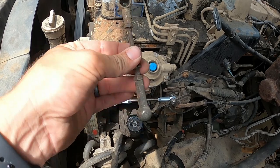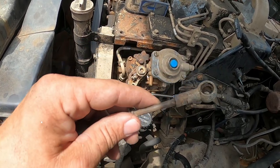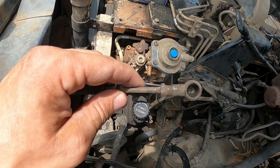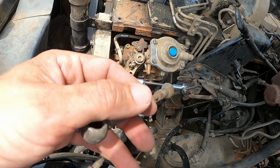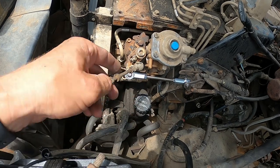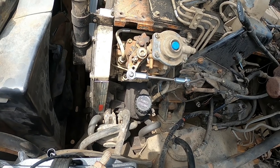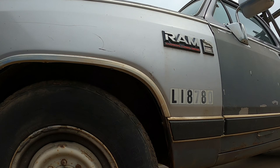We're going to throw this old junky thing away — all the play in it, it is going away. I highly suggest if you still have the stock linkage on your first gen, chunk it as far as you can because it'll fail at the worst possible moment and you'll have zero accelerator. Just go ahead and spend the money now, or get some all-thread and some heim joints yourself — you can probably do it for less than five bucks. Thanks for watching, and I hope you learned something, especially if you didn't know these linkages were junk on the first gen. Hit that like button and subscribe because we have a lot more coming your way.